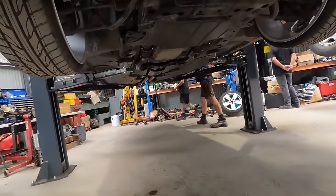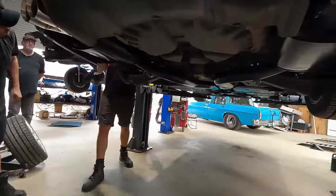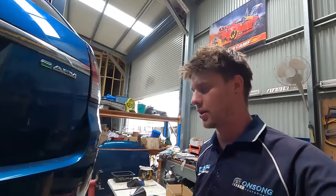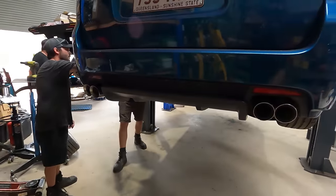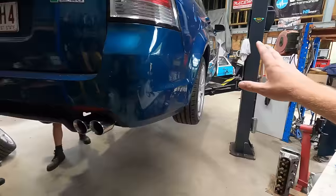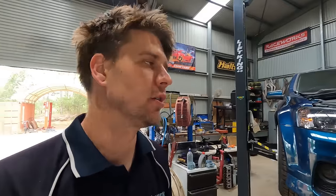Bo's smashed this out - it's all back together, we're ready to go. New exhaust is on, new OTR, new trans cooler. So we've got our full Black Ops exhaust - same one we've been putting on basically all of these lately, we've been really loving this exhaust. The boys are getting the coilover setup sorted at the moment. With the twin three-inch, you lose a lot of room underneath the diff, and we've had issues in the past with other cars destroying that part of the exhaust. So we need to lift it a little bit. We also still need to roll the guards for the Simmons to go back on once it's all set up. So hopefully once it comes off the hoist, gets tuned, it doesn't have to go back on the hoist - we can just put the proper wheels back on it and it can go on its way.